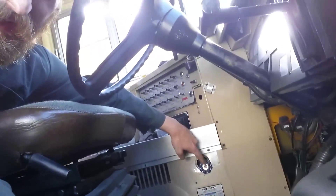I'm going to drain them, cut them, and then route them into themselves. So in case anybody ever needs to not listen to me and turn on this valve right here — if they turn it on and I don't do anything about capping it, it's just going to be coolant sprayed all over the interior of the bus. So I'm cutting them and routing them into themselves. I hope this makes sense. I don't think all buses have that, but mine does.